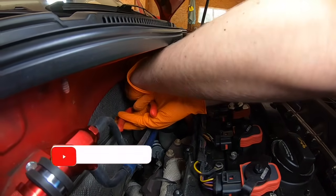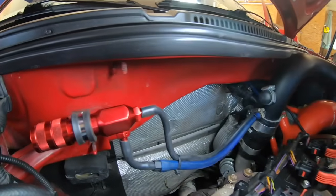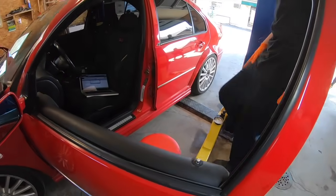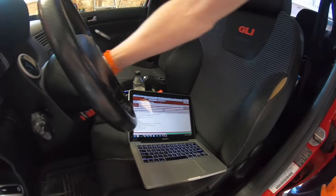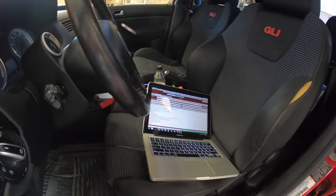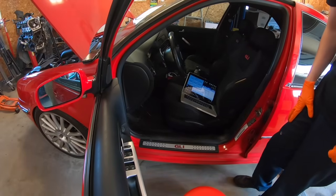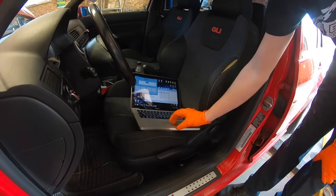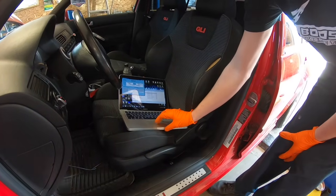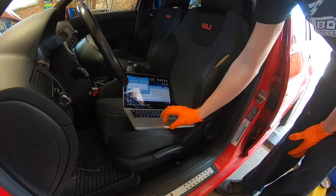Everything is pretty tucked — that's how it should look at the end of the day. Trying to make it as clean as best I could. The flashing has finished up — I'm going to press OK, which only took 2 minutes and 30 seconds. Key off for about a couple seconds. Whenever doing engine control module swapping, ECU swapping, or programming, you always want to adapt the throttle body. Some cars when you put ECUs in they kind of run like junk for the first couple seconds or even until you get it warm and adaption starts setting in. Got it adapted — done. Fault codes: zero. The N75 is unplugged but it's tuned out on my tune.